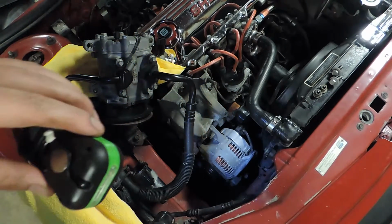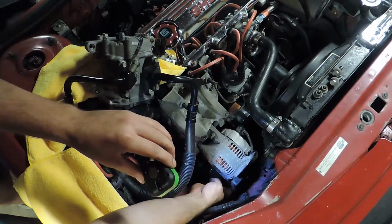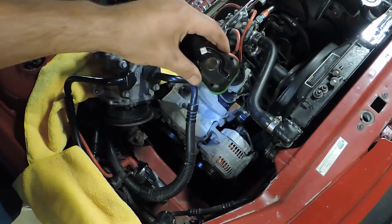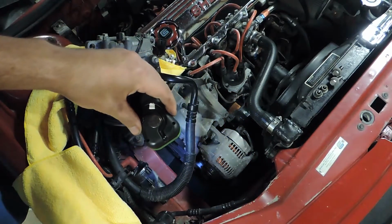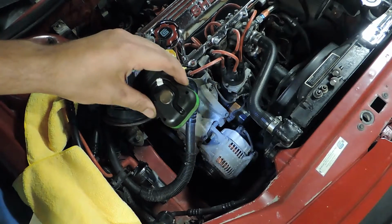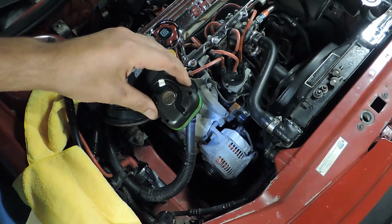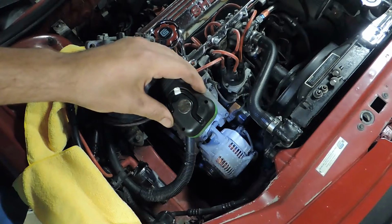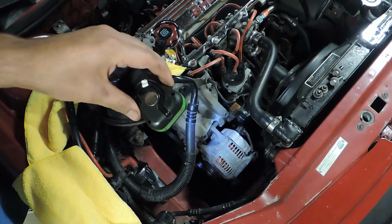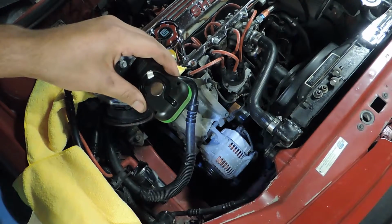And you can see down here that we do have the bolt right here that will come out and release the top ear of the alternator, and then there's the cross bolt that goes through. Usually it's a 14 millimeter on that. I think it's actually an English size for this bolt, but nonetheless 14s will do ya. And we'll go ahead and get these babies out, the bolts here, and the alternator will come right up, and then we'll just have to worry about our connections going on the new one after they come off of this one.